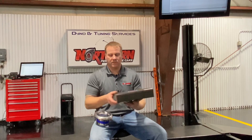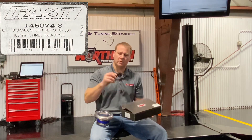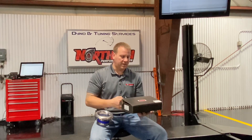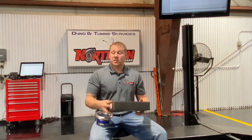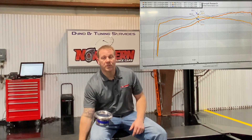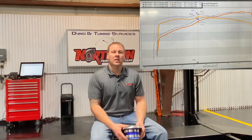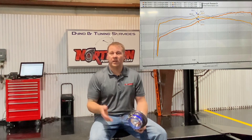The short runners did exactly what we expected and lost a whole bunch of torque around 3000-3500 RPM. These are part numbers 1460074, and this makes the runner length about 7.25 inches according to FAST. As expected, the long runners made peak power at around 6200 RPM, the mid runners made peak power at 6400 RPM, and the short runners made peak power around 6700 RPM. Ironically, all of them made 555 to the tire — within a decimal place — some 553s and 552s, but for the most part they all made the same power. The runner length just dictated where it made that power, with the obvious torque loss with the shorter ones.